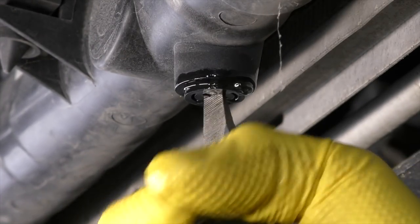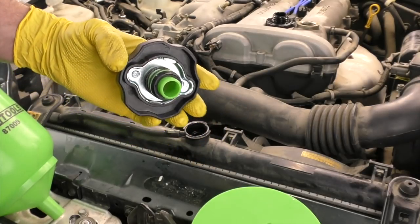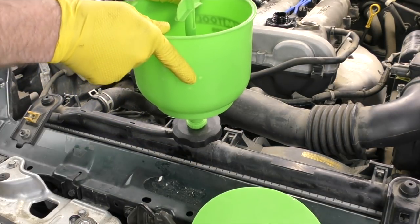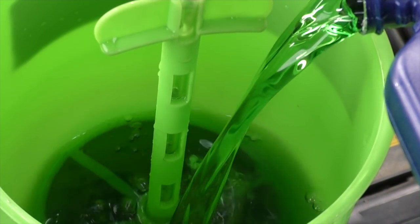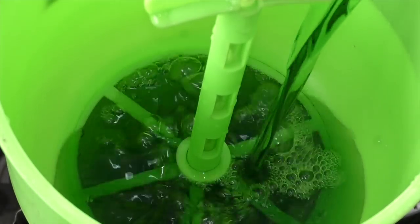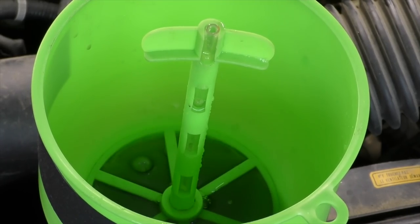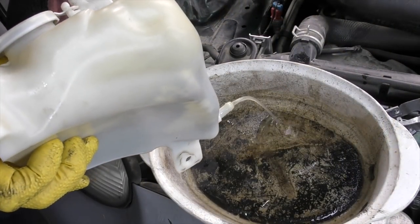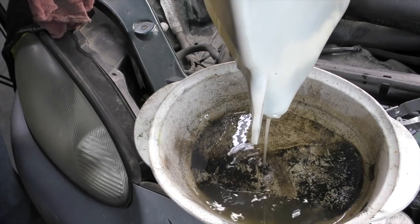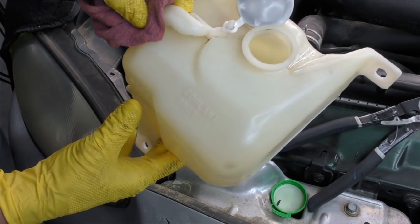Whatever chemical treatment you use, be sure to flush the cooling system out thoroughly and make sure you don't leave any of that chemical behind. Once that's done, drain that water out and fill it up with good fresh clean coolant. I love to use a funnel like this when refilling — it allows the system to fill and lets air bubbles bubble out without making a huge mess. I put this funnel on as soon as I close the cooling system back up so it has as much time as possible to bleed the air out. You may still need to start the car and let it run to get the final air out.